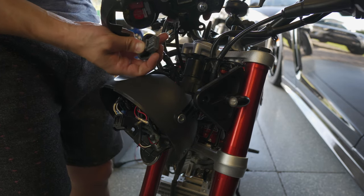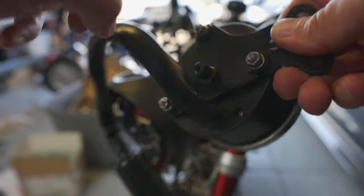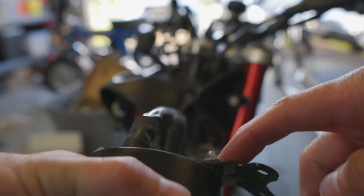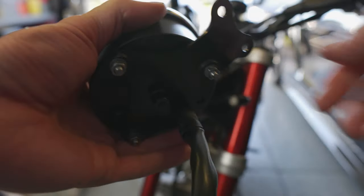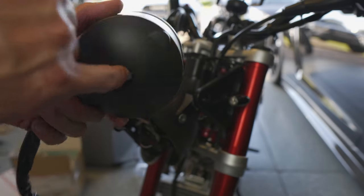There's just a plug that pulls the whole thing off. I've got the mounting bracket onto the speedometer — there are rubber grommets that go in between the bracket and the speedometer, then an 8mm washer and an 8mm nut. I also added a little bit of Loctite since my bike rattles quite a bit, so it doesn't rattle those nuts off. The outer housing goes on with a 3mm Allen key at the bottom that secures it around the entire speedometer.